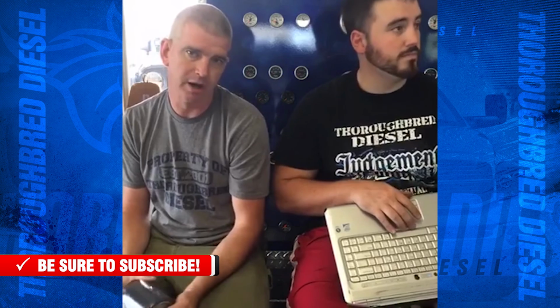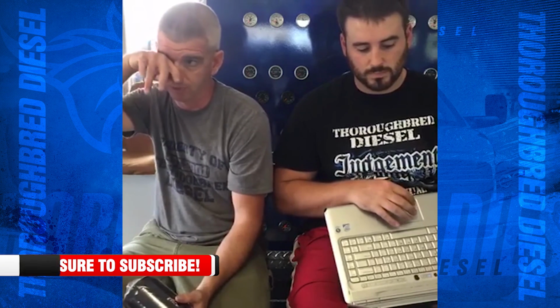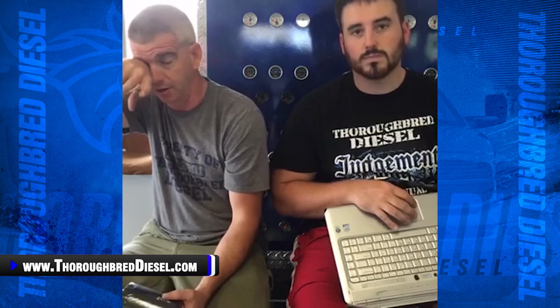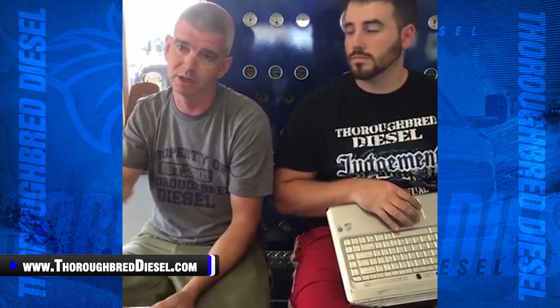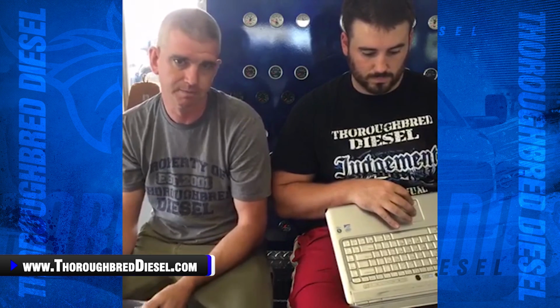The nut upgrade actually has Allen set screws in it. So when you put the upgraded fifth gear nut on, you're able to go through and torque the set screws down. That, in theory, is supposed to keep it from coming back off the transmission. And it does work if you use the proper torque sequences and all of the Loctite that they suggest you to. So as long as you follow the instructions that are in the upgraded fifth gear nut kit, you're going to be fine with it.